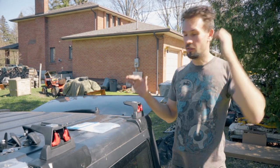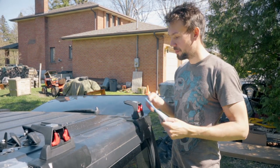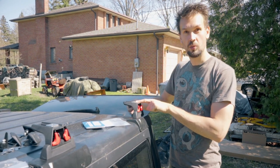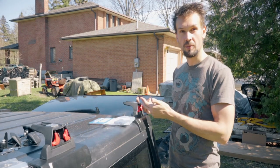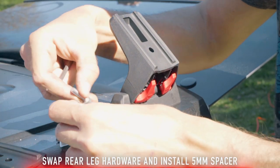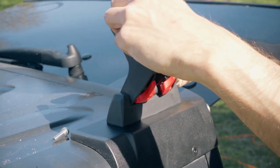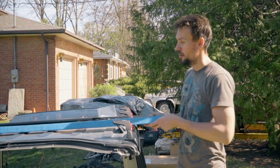Now I want to turn attention to the rear of the Jeep. We need to install that spacer kit, which is going to bring the rear bar up slightly — the back piece is probably down by five millimeters. We're going to have to remove the existing hardware and fit the spacer in between. The spacer comes with additional longer bolts, so we're going to swap those in — take out the old bolt, swap in the new hardware, slide the spacer on, and do that on both sides.